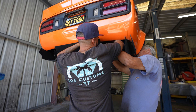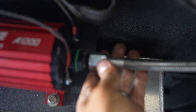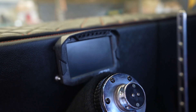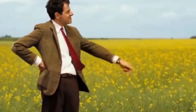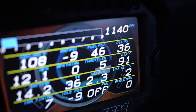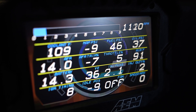Now that we have the power and ground connected, let's put our hose in — everything's connected. We're gonna do a test fire and see if we've got pressure. That sounded pretty good. Look at that pressure — 46 PSI, solid. It doesn't fluctuate, doesn't make any weird noise, it sounds good. We checked the leaks — no leaks. It even sounds a lot better already.